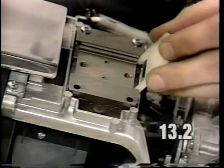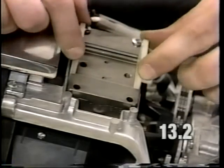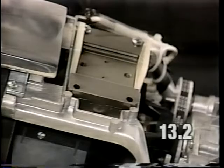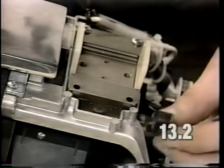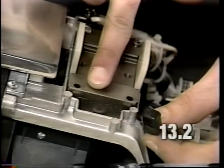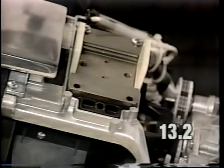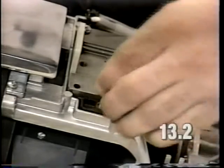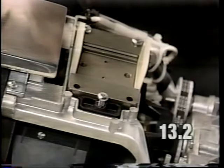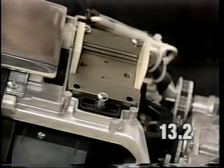Next, line up the slide and bearing cages by inserting the T147S shim tools. This ensures that everything is lined up properly and at the center of its travel. Next, install the wedge. The flat side of the wedge rests up against the left side guide block. Install the wedge screw. Tighten the wedge screw down to 4 inch-pounds on a G4, 5 inch-pounds on a Generation 3.